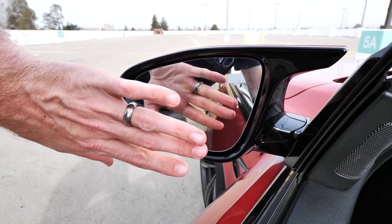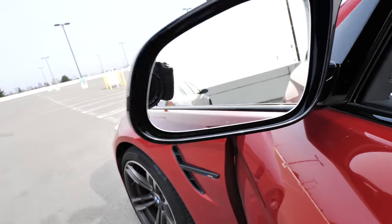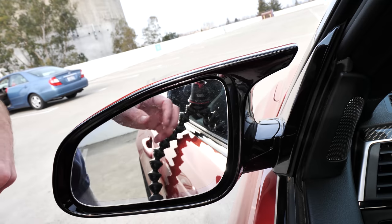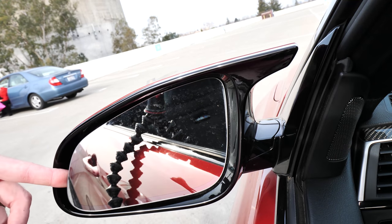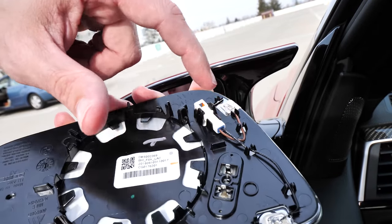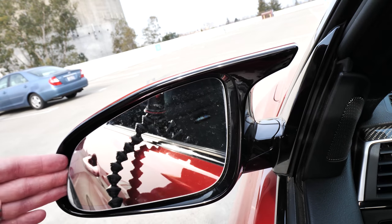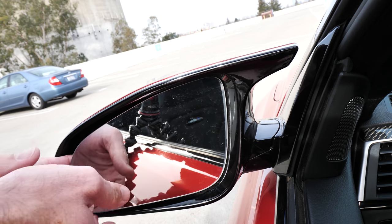See my hand there in the mirror — this is kind of the view we get from directly on. Once we get that other mirror on too, I want to show you the difference. You can already see that it's much more wide angle. I'm going to try to do this without any tools — just move the mirror inward most to the car so I can basically get my finger in here. Now, if you look at the backside of the mirror, you'll see this circular little area where it clicks on, and then you obviously have the wiring here, here, and here. As we bend it inward, that's the best way to do it so you're not going to rip up the wires, but obviously be careful. This is glass — it is a mirror — but give it a little bit of a pry and it should pop right out.